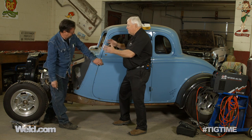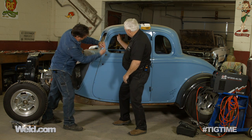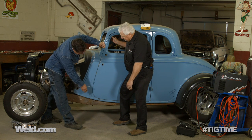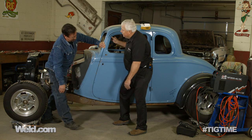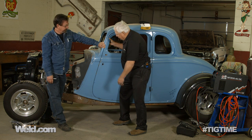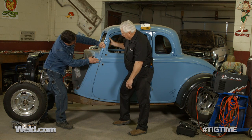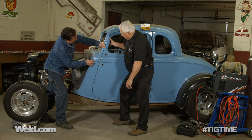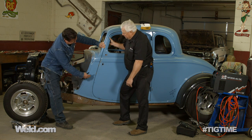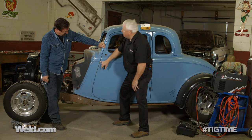Here's what I noticed — you have to tell me, what are the highs and lows? What do you look for in door alignment? Well, you'd like it to be consistent all the way around, with enough gap so the door will shut without rubbing the paint off the finished product. You don't want to spend a lot of money on a paint job and have the doors rub that off. Consistency — the same gap all the way around — is just a cleaner look. That's what car guys are all after. From your cowl panel here to your door, if you can get these in line, you know the rest of your door is in line, which we have really close right here. It's the gap that we're concerned with now.